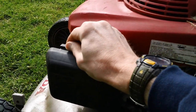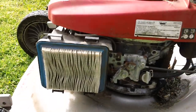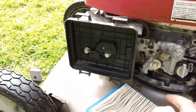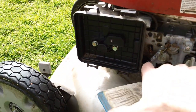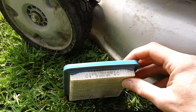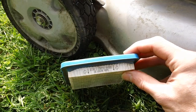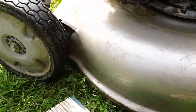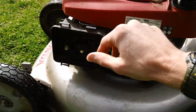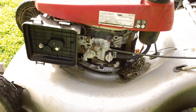We'll go ahead and open up the air box and show you what the air filter looks like. And there's the air filter — I can't believe it, they got a Briggs and Stratton air filter in here. Somebody put a Briggs air filter in — genuine Briggs and Stratton. Somebody stuck it in there. So you actually can use a Briggs and Stratton air filter for these machines because the air box dimensions are extremely close and similar to the Honda air filter design.